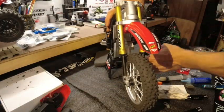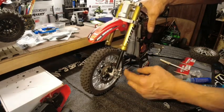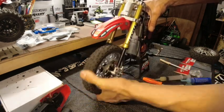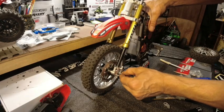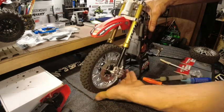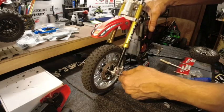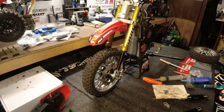The VITAVON brake rotor and caliper and pads together, it's a very tight system. So I think what I'm going to have to do is, I already backed off the piston as far as it will go. It's not engaging the pads anymore at all. So I'll probably take the pads out and grind them down a bit until they pass smoothly in the wheel here. So that's what we're going to do right now.